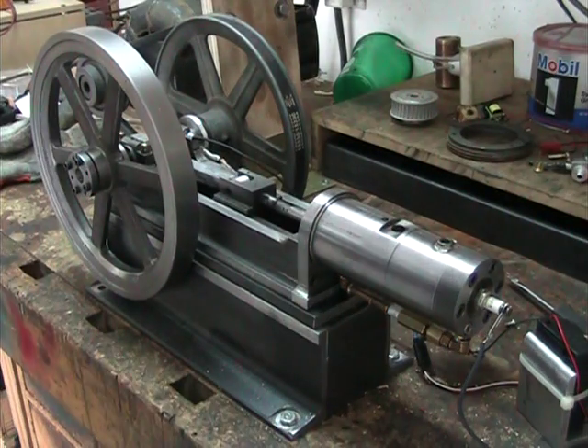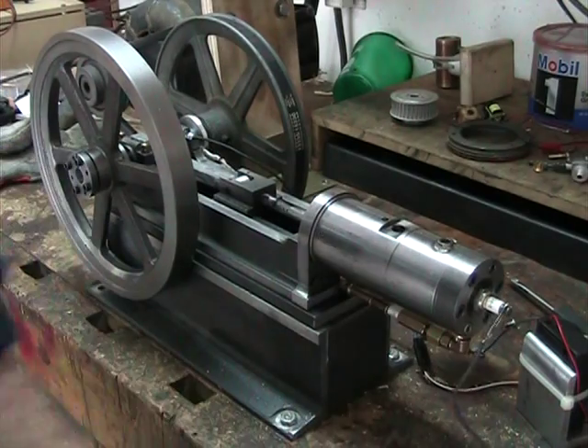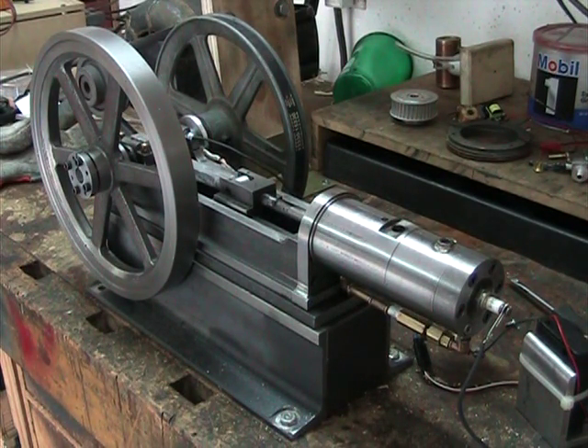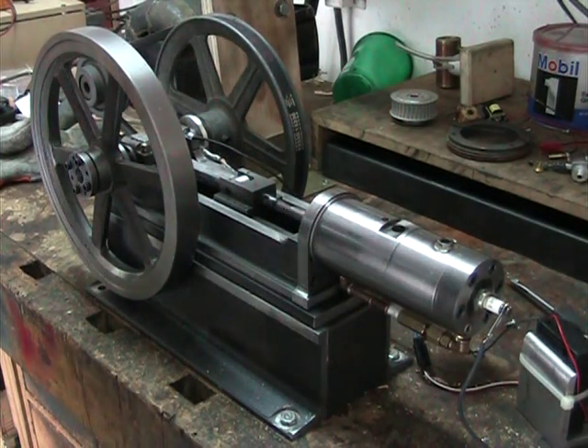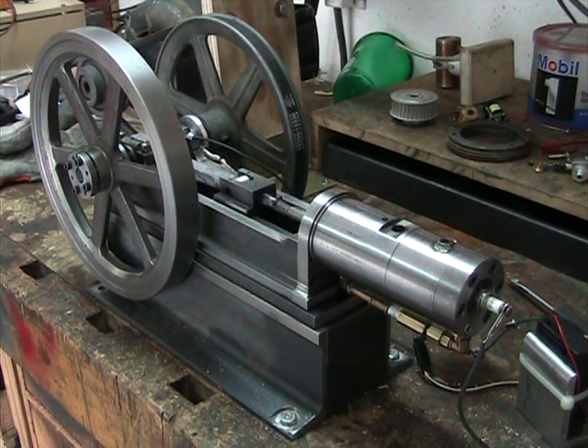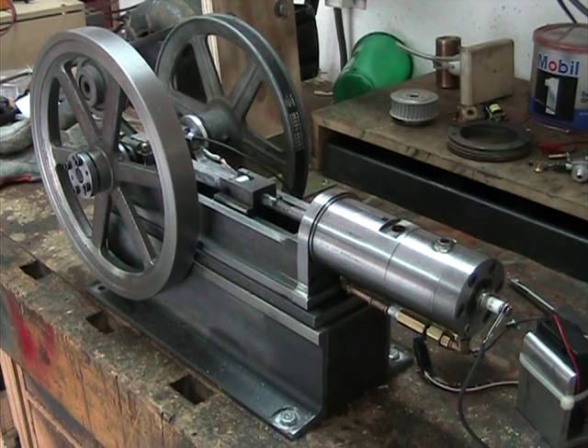That's where it is at this point. I think there's probably one of two things going on: either I'm not getting enough air-fuel mixture into the cylinder, which means I need to redo the pipe plumbing with a larger size pipe. The current setup is about 5/32nds bore with two ball check valves, and the carburetor has a 5/32nds inch venturi. I'm using quarter-inch OD pipe for the transfer port. The next step would be to go to 5/16th pipe with a minimum of 3/16th, maybe 7/32nds ID, which should give quite a bit more fuel-air mixture into the cylinder. That's where it stands for now — thanks for watching.